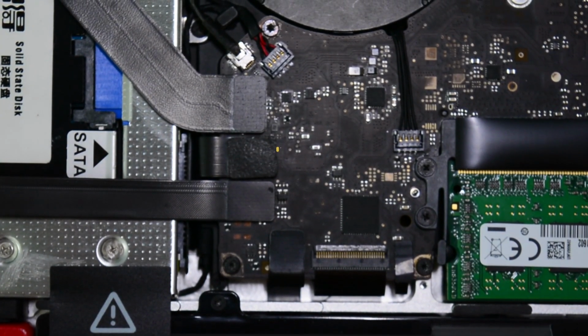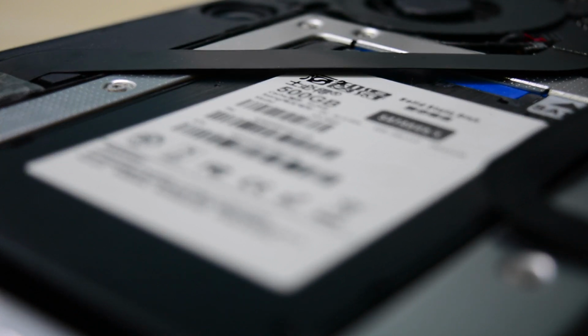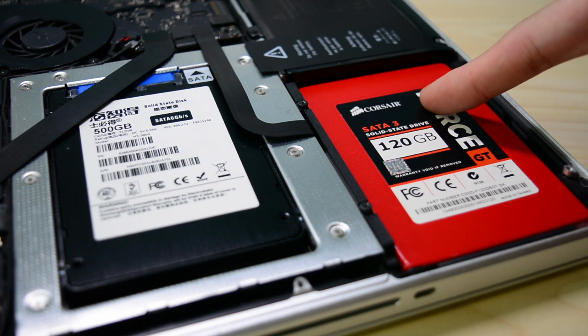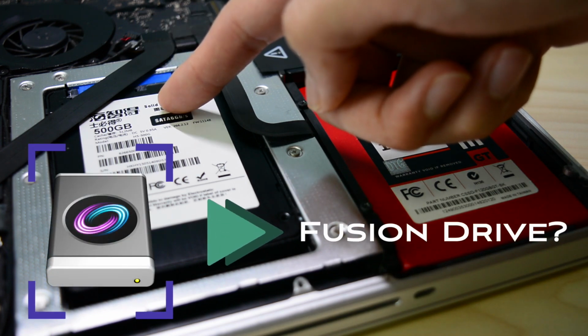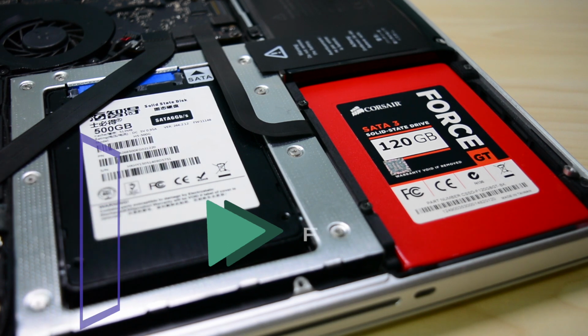Just remember that this space can't really accept the thicker hard drive, like those 1 terabytes or up. So I recommend putting the hard drive on the original hard drive spot and the SSD on a new slot. And I've heard you can do something like Fusion Drive within macOS. You can do more research about it and leave a comment down below if you've got good results to share.